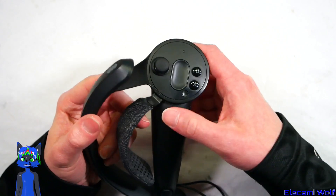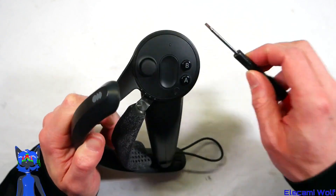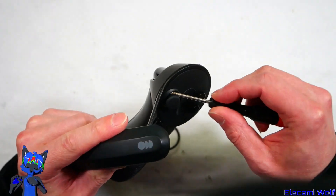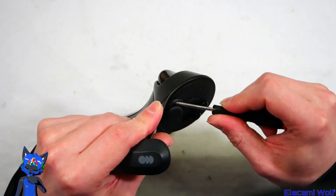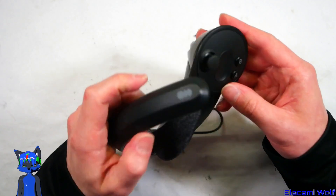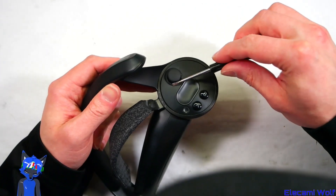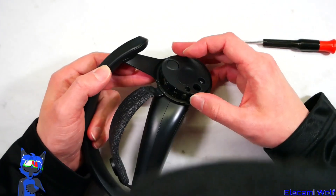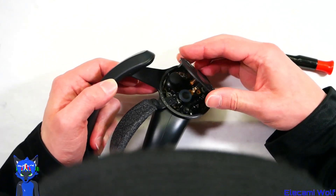Here's what you need to do to take apart this top part of the controller. This line here is where this center part will come out, and one way — maybe not the proper way — is to insert a flat screwdriver into there and push it down to lift it up. It's going to be at an angle and there's a clip down there. Now get your spudger tool or your fingernails, lift up the rest of it, and be very careful because there's a ribbon cable coming off there which needs to be looked after.